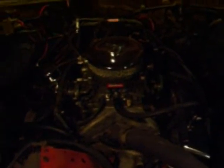I'm not going to go into a lot of detail today because I'm freezing for one, but if you get pinging going down the road at high speeds, or you have a flat spot and everything else is running fine and you just did your vacuum, change your distributor or something, you want to check your vacuum advance. But now I'll go over to another carburetor that I already have out, and I can go in a little more detail on certain things. This is a 327 in my Nova, and hopefully this video helps somebody. I'll get the other carburetor out here in a second.